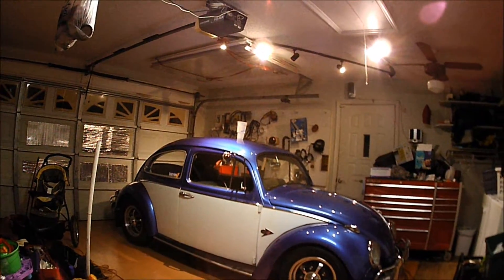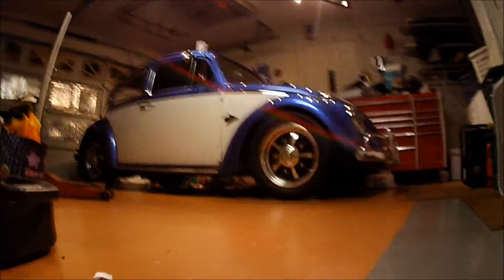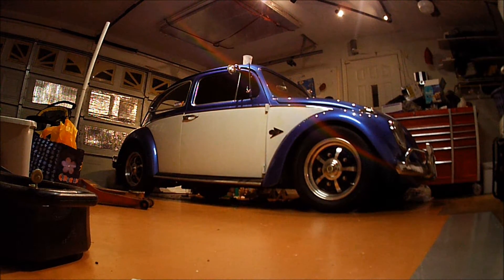I should have gotten a comparison shot from back here before we started, but to me that just looks a lot better — it's got a little more street machine look to it. If you have an adjustable suspension in the front, there are two main types of adjusters to look for. You have the Avis or Puma style adjusters, which have serrated plates that you put in different angles. Then you have the Sway Away style, where your grub screw is right here and it has an adjuster that pushes up or down — your torsion springs are always pushing down, so you can adjust it up or down with two nuts on each adjuster. There are three styles in all reality, but nobody really uses the selective drop anymore — it's very archaic looking with a big ball-thread piece connecting both adjusters, and reportedly makes for a hard ride.